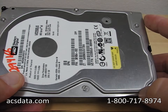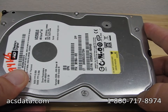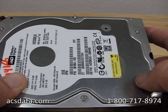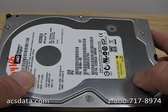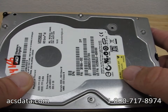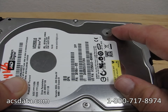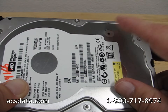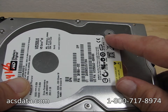The other misconception with hard drives is that they are airtight — "hermetically sealed" is a term you've seen thrown out there a lot. Nothing could be further from the truth. Most hard drives need to have airflow in order to allow the drive to function normally inside. In fact, a lot of drives have holes on the case cover that specifically say "do not cover" because they are air intakes for the drive.